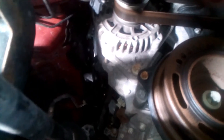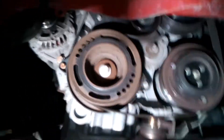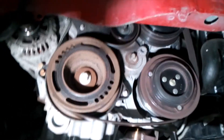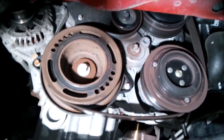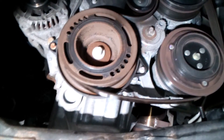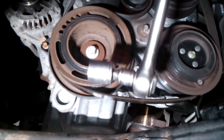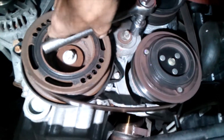Now that I'm down here, here's a better view of the alternator. My next goal is to get this belt off, so I've got the belt loose. This is your belt tensioner. What I used was a 19 millimeter 1/2-inch drive socket with a one-inch extension and my ratchet — just simply put it on here and crank down on it. It's got a lot of tension so you're gonna have to really put some effort into pulling that thing down. Now my belt is off.